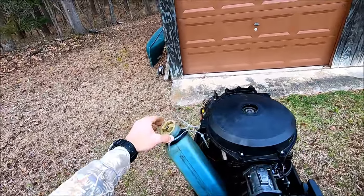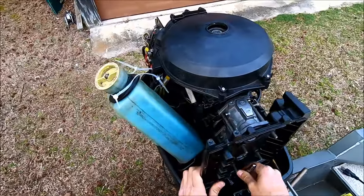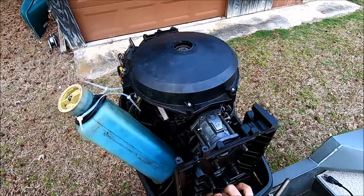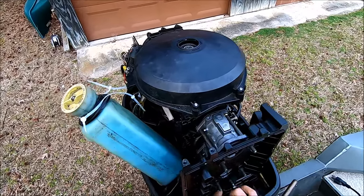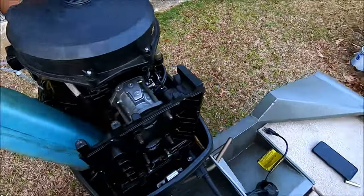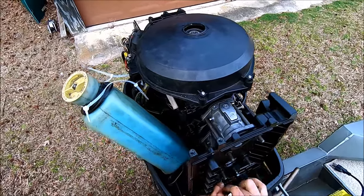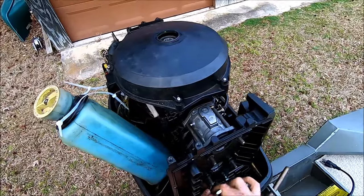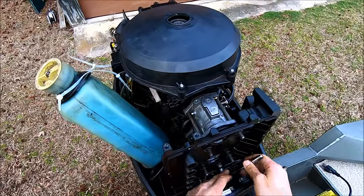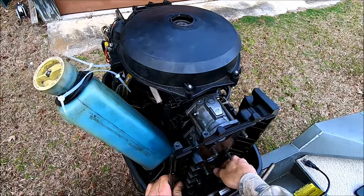Alright, we got the tie wraps wrapped around the front so that's out of the way — don't have to worry about that anymore. Let's get this plate off. After we get this off you have to cut the tie wraps or take the clamps off the fuel line so you can get the carburetors off. These bottom bolts are the most aggravating thing to deal with in this whole procedure. The UPS man just rolled up — he's got my jets, just dropped them off, so my wife is going to bring them to me here shortly.